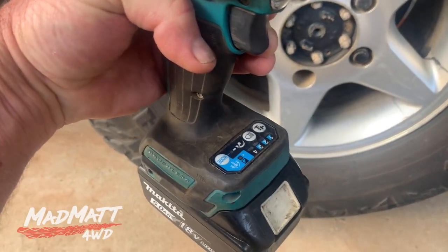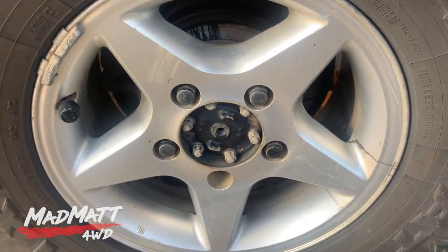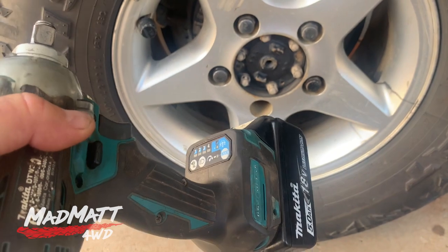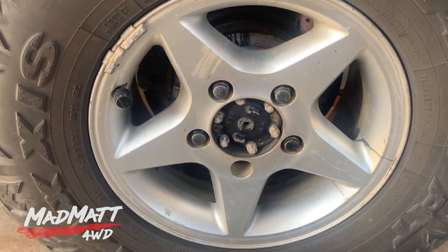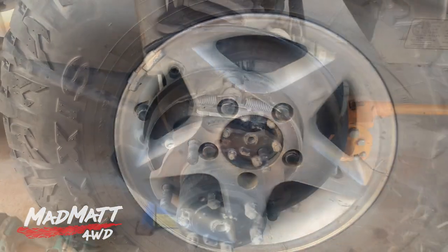I torque these on a low setting of two and I always tighten them up further with a torque wrench, so I know that's good to go. But you do want to be careful — your rattle gun set on, say, four can give you some real grief by busting your wheel studs. Let me know in the comments down below if you've ever had a wheel come off your vehicle. I never have — this is as close as I've ever come.